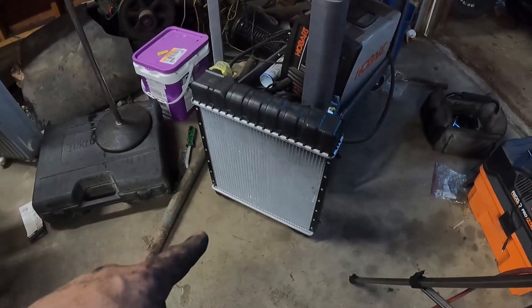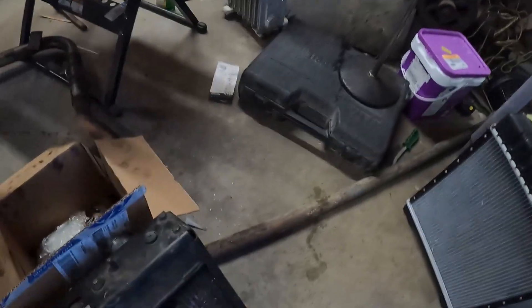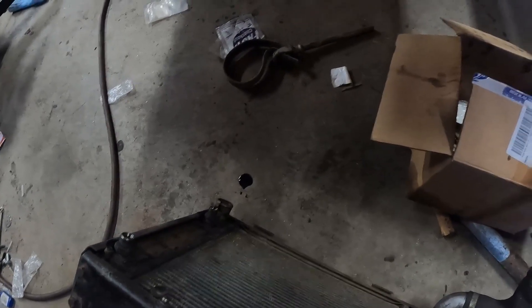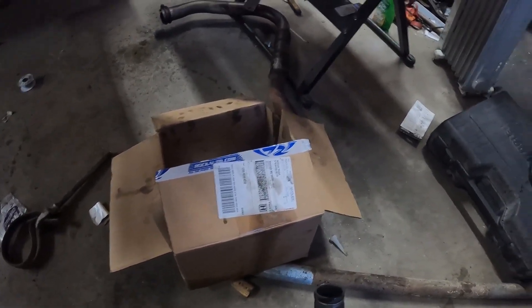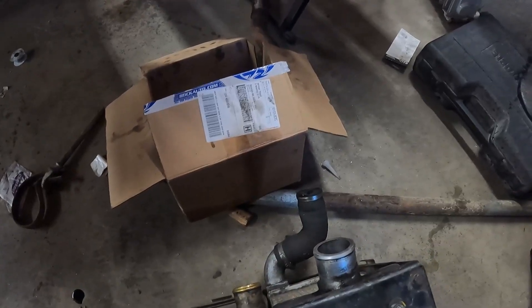There's my new radiator — it's to my shame a Britpart, but I want to get my original radiator re-cored. If you look at one side it looks really nice, but the other side is just crumbling apart — all the fins are dead. Being as it was in an engine that blew up, there might be metal trash in the oil cooler, so it seemed smart to replace the radiator even with a cheap one for now.